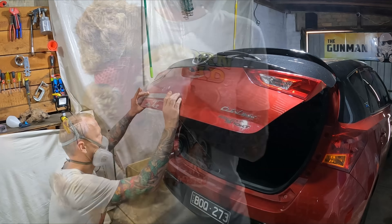Let's kick the dog out so she doesn't breathe in all these nasty fumes, and back on with the job. What you see me doing here is just getting that ruler to make sure there's no high spots. We can deal with low spots with a little bit of filler, but as long as there's no high spots we should be all good. I'm just running any straight edge over the surface to check.